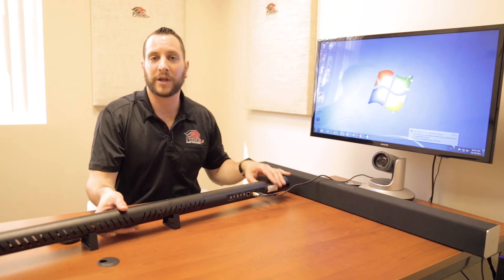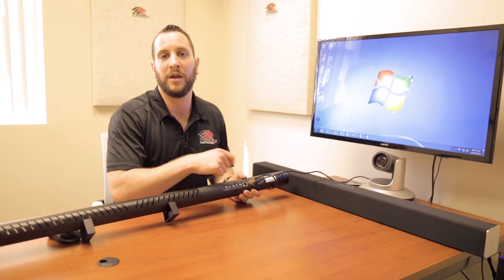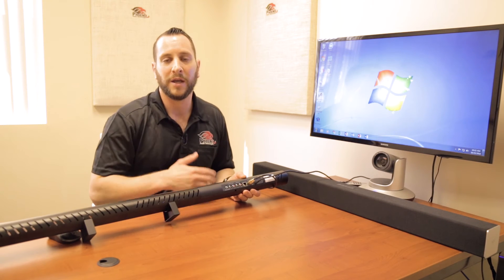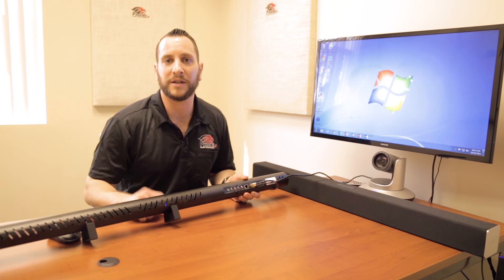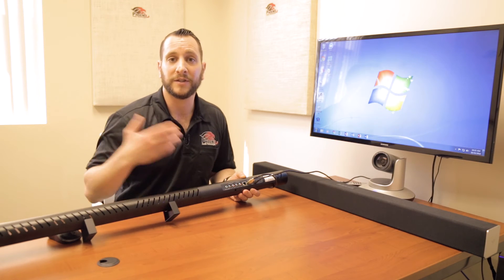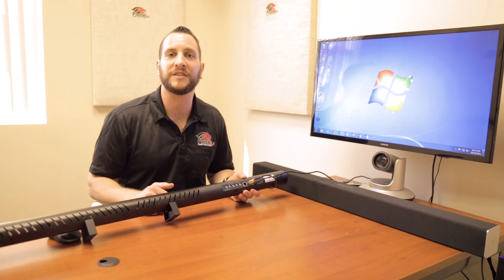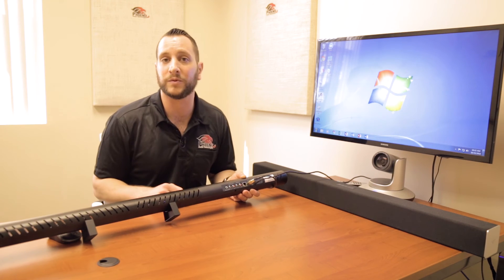If we wanted the Condor to work as a SIP phone as well, all we need to do is get a Cat5 cable, plug it into our ethernet jack, and then put the other end of the cable into the wall socket. The Condor will get an IP address and log in and you'll have a SIP phone as well. The Condor also has an analog interface, so in case you want to plug it into an old video conferencing system that doesn't accept USB — just analog — you can use that as well.